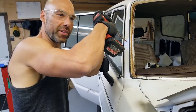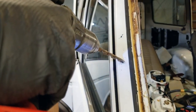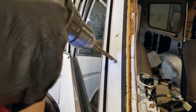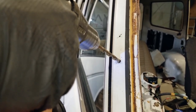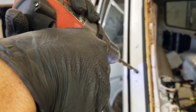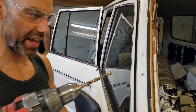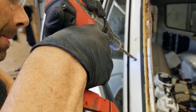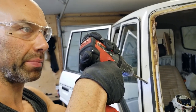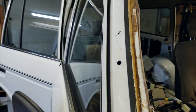It's always painful to drill into your Land Cruiser. Almost through - lighten up on the pressure. What can happen with thin sheet metal is the larger drill bits will grab and snag the metal and start to rip it apart a little bit. So when you feel like you're just about through, back off the pressure - sometimes it helps to even speed up the drill bit a little bit. Not a bad looking hole.